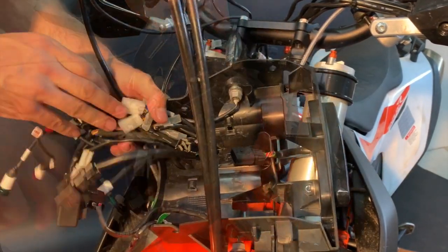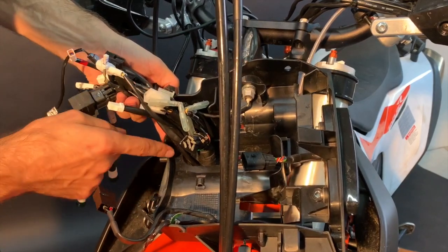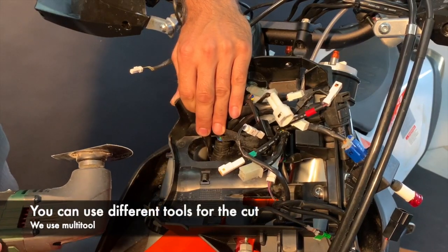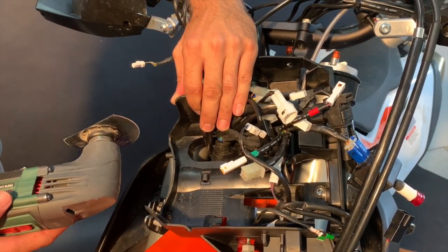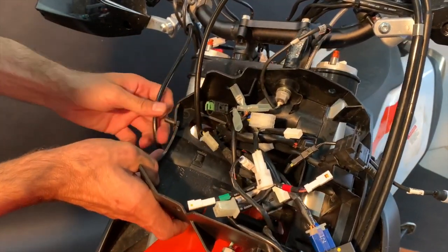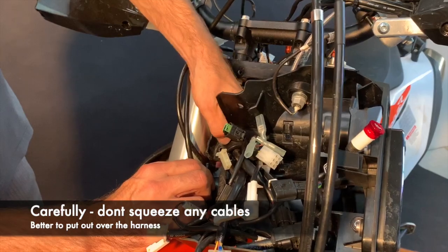You need to get the big harness and the brake hose out from the mask. We suggest cutting in one more area, in between these two pins. You have several options — either a sharp knife or a multi-tool. Be careful about the brake hose and the other harness — put them as far away as possible. Now take out the brake hose first, then very carefully the harness.